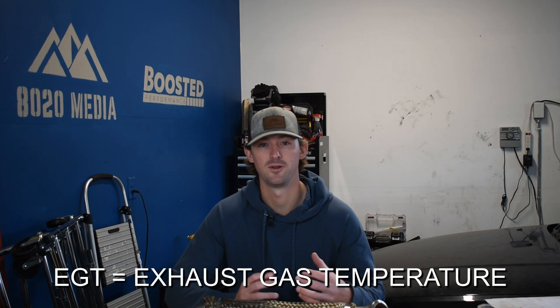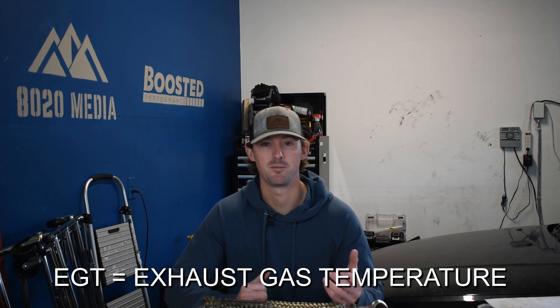While the factory intake system is strong enough to handle some of these power levels, there are certainly zero downsides to adding an upgraded intake. Once we're tuned and running more boost from the turbocharger with a cold air intake bringing more air in, it's important to look at exhaust components to get more air out of the engine quickly. When you're running more boost and creating more exhaust gases, you get a buildup of back pressure within the exhaust system. This back pressure works as a force against the turbocharger — it slows down turbo spool, puts additional stress on the turbocharger, and leads to higher EGTs. So we want exhaust upgrades to lower EGTs, reduce back pressure, add reliability to the turbocharger, and help it spool more quickly and operate more efficiently.